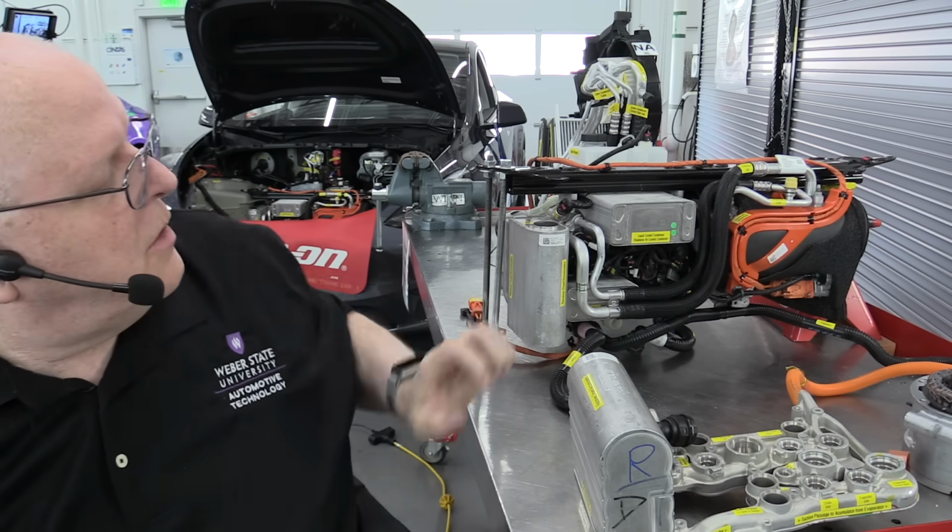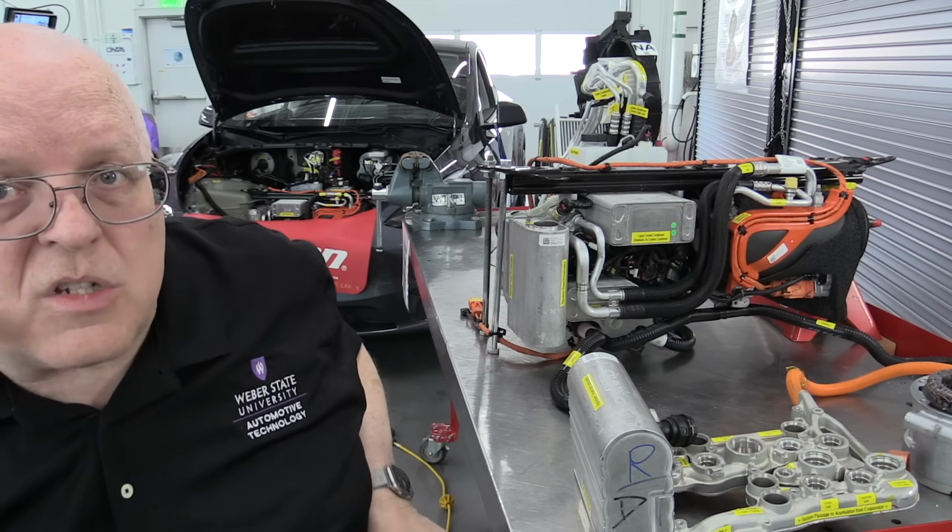This same heat pump system that we're looking at here and describing here for the Model Y is the exact same system on the Model 3, the Model S, and the Model X. They all have the same heat pump system. They all have what appears to be the same supermanifold and air conditioning compressor setup. So it's a modular system that can bolt into multiple vehicles and then just have the existing parts, coolant hoses hooked to it, and then the refrigerant lines transfer into the cabin as we have discussed.